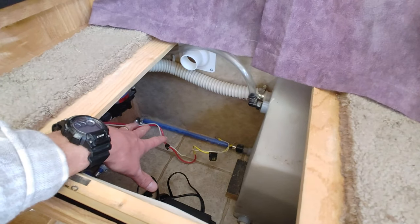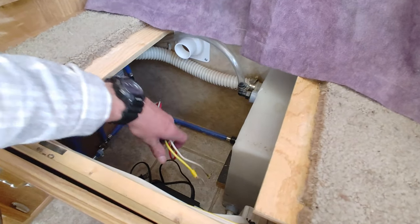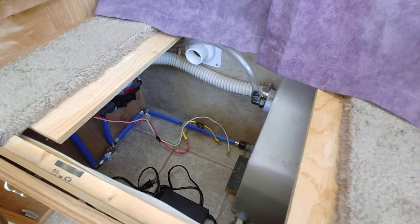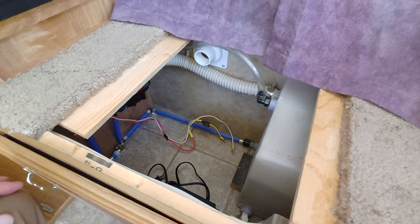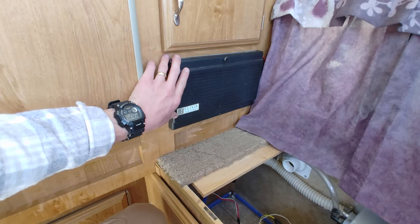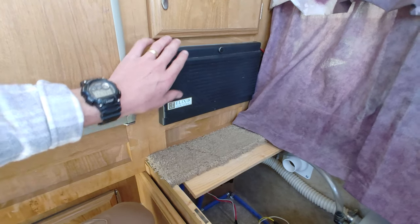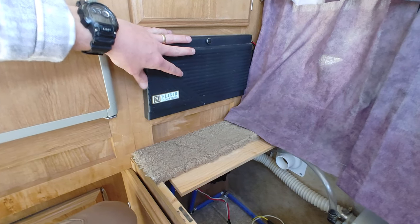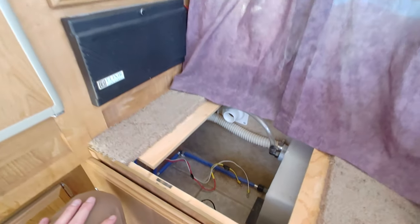Next to this, there's typically a battery that you can put here — there used to be one, but when I purchased this camper it did not come with a battery. It has a converter charger, not an inverter charger, and I'd much rather have an inverter charger. This is also a very cheap brand — they're known to fail and destroy batteries, which is kind of why I have yet to put a battery in there. I will talk about how I handle power in just a few minutes.